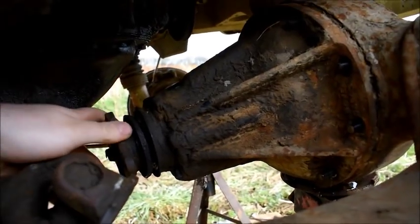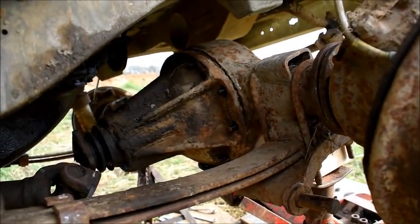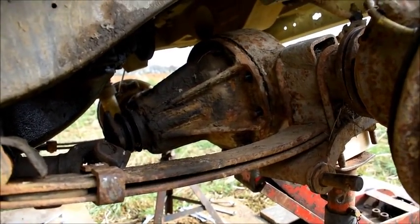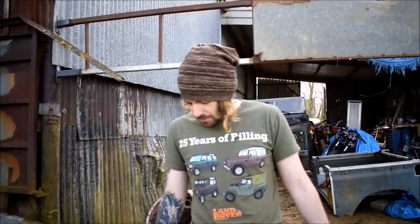I'll get the prop out of the way. I'll show you when it's all out of the vehicle compared to the other diff — it looks a bit knackered. Hopefully my halfshafts are okay in the front. I'm hoping it's a total failure of the diff and I can just whack another one in, put the halfshafts back in, get the water out, put the correct oil in, and off we go. So the diff is out now. The halfshafts are fine. What it was — the bearings, as I already knew, were going, hence the noise and the play in the prop shaft. Then that time we used it to tow someone on the track in the snow — even though I didn't want to use it because the Land Rover was already poorly — what I did was disintegrate the bearings even more, so the play was so much that it then lost its drive through the diff.